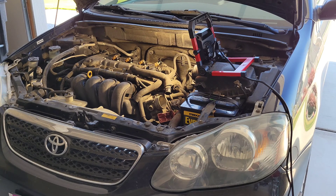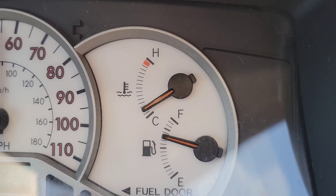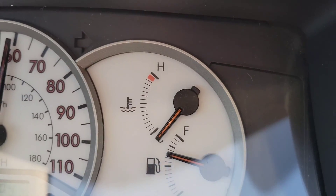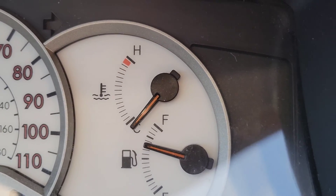Last night my wife and I were going to Target and we were on the freeway. As I was hitting the acceleration and letting off, the car was jerking a ton — something was definitely not right. My wife noticed the temperature gauge was going all over the place, really sporadically bouncing back and forth. She captured video of it while I was driving. After doing a little research, I found the most likely culprit is the ECT sensor, which is the coolant temperature sensor.